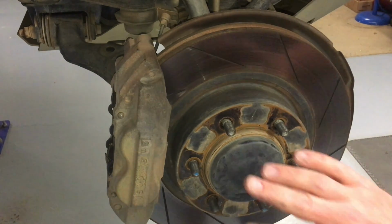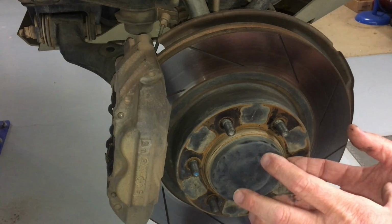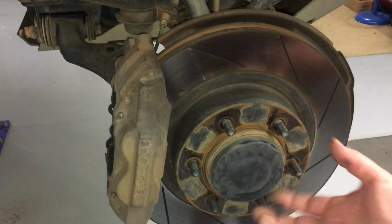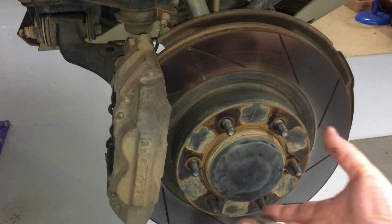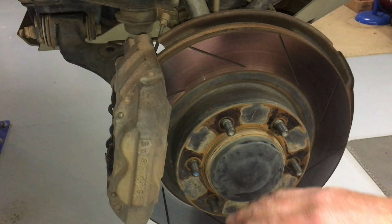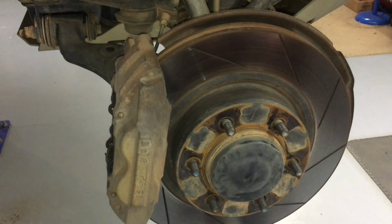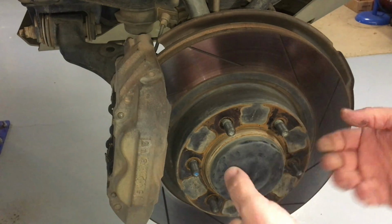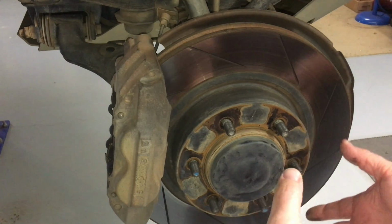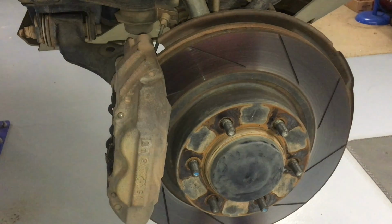17mm. Once you've got those 17mm off, nothing's holding that bearing from coming out this way, okay? That's what happens, it comes out this way. That assembly, you're going to be holding this hub here, but it's all pressed together, and you're just going to wiggle and pull. You might just get a hammer and gently tap, tap, tap the end of the drive shaft. It's okay for some gentle tapping, no problem. The thread is nowhere near the end of the shaft. Happy days, tap, tap, tap, and pull this, tap that, and it'll just come off, right? There you go, the whistle worked that time. It worked twice in a row.